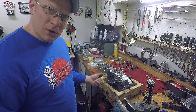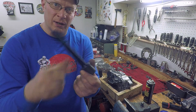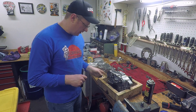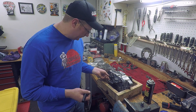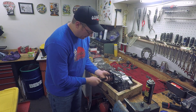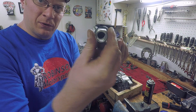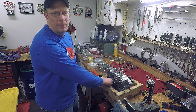I almost forgot to put the crank in, so I'll be using this Tusk crank puller tool — basically a threaded rod with threads on the end. This nut passes through where the flywheel goes, and you thread the flywheel nut onto it — it doesn't need to be tight, just needs to be on there. The threads on the inside are the same as the threads on that silver nut, which threads in here. The puller assembly goes into this hole, pulling it through with the nut. The face of it goes where the oil seal is on your flywheel side.